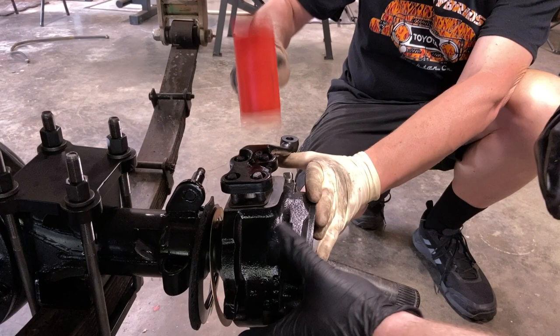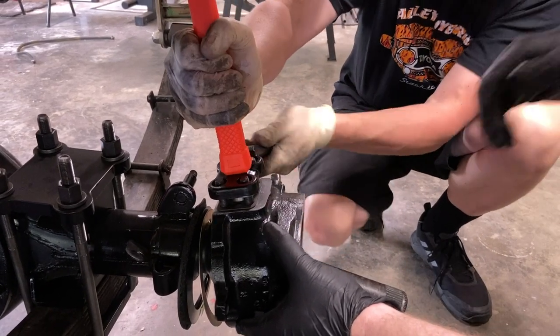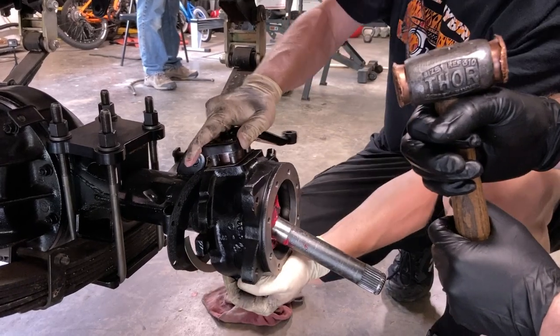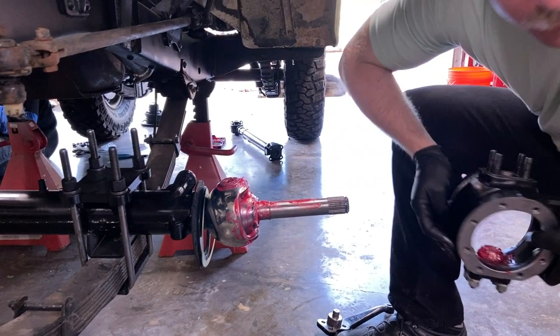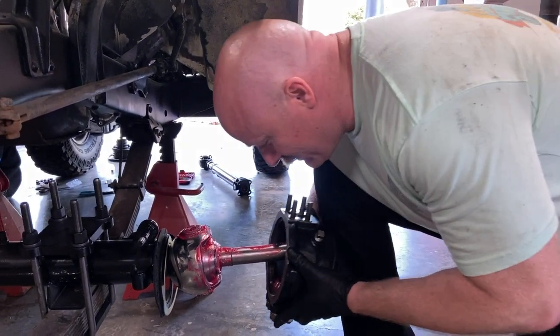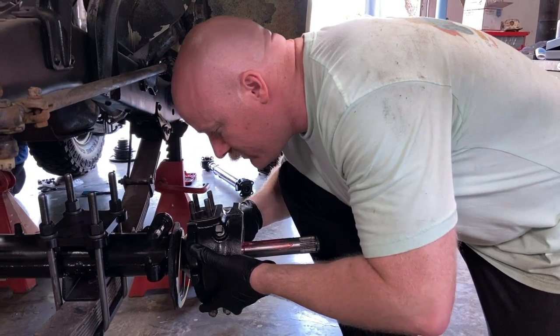There's an R. So I have the left knuckle here, right? Yeah, you want to try the orange or do the work twice? I love doing stuff twice. All right, mallet and shims. Did I do the sleeves right? Okay, so put a thick shim on there. You got your steering arm — slide it in at 45 degrees from the bottom, get the bearing in there, pull up, there you go. Make sure it doesn't flop out of there. We did paint the living daylights out of it. 45, there we go.